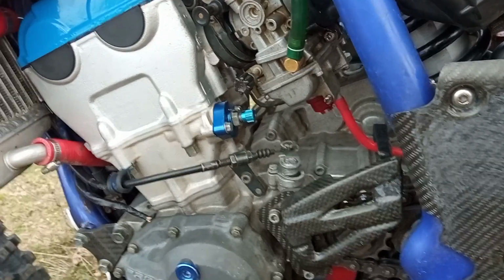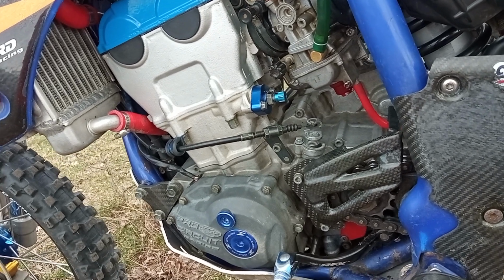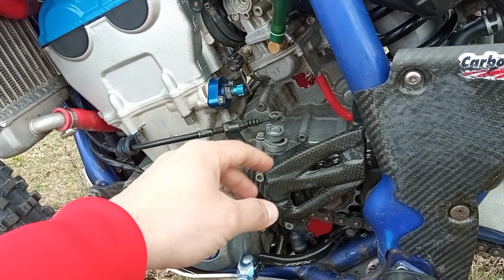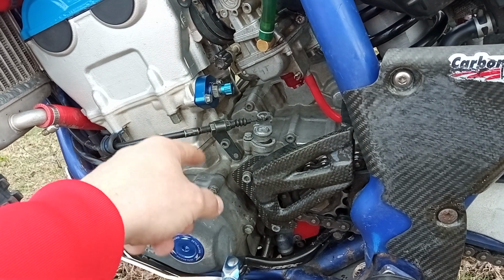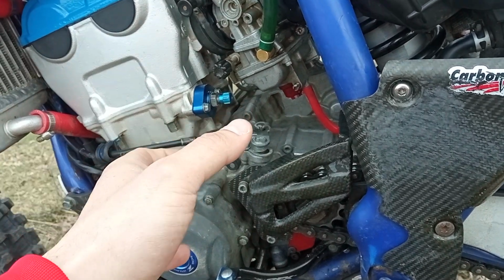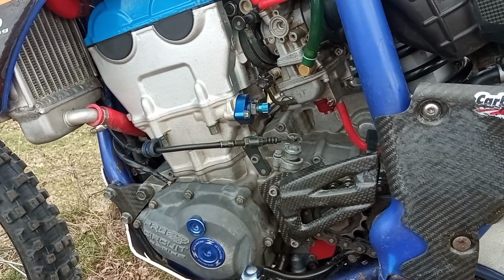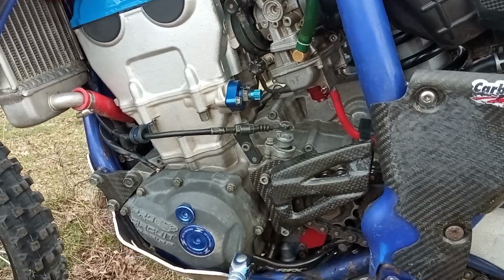The original one I have, the timing chain tensioner, but I didn't want to risk it because I saw many had the problem that the timing chain backed up and destroyed the engine. So I didn't want to take the chance and bought this manual cam chain tensioner and installed it, set it as it should be according to the setting chapter, and the bike runs well. Since then I've not had any problem, whether I rev the bike or not. I'm confident it will not back up.